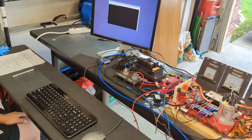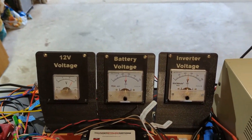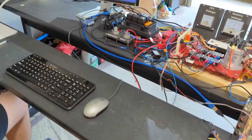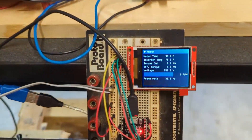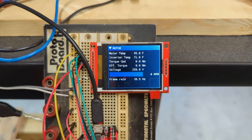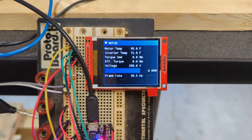Okay, we're in forward. We've got good battery voltage, good inverter voltage. Let's start — here's the motor RPMs and torque commanding. Why don't you go ahead and get it up to maybe three or four thousand and we'll see what it sounds like.